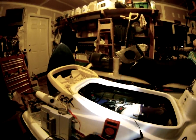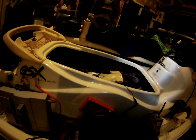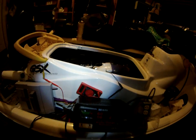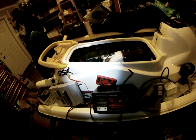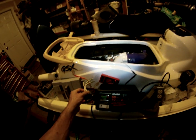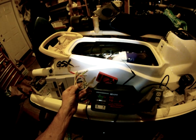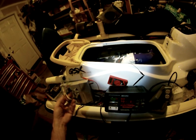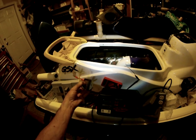Before I replaced that regulator or rectifier, it did not go up to 13 or 14 volts. You just saw it go to 13 or 14 by replacing this part, and your high RPMs will be okay. That part cost me fifty-six dollars.